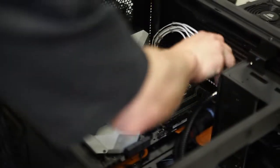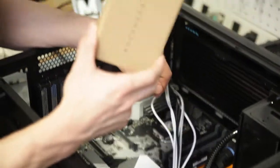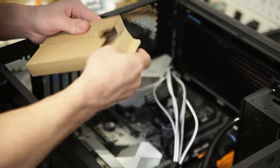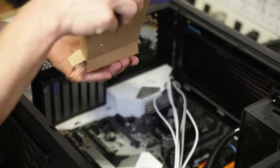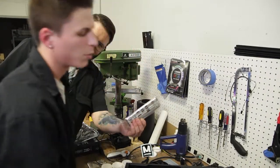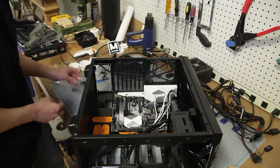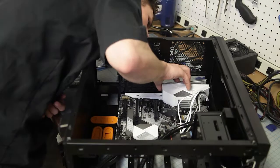To install your motherboard to the case, you're going to need to go into that accessory box, which has all the screws you need to mount the motherboard. If you wanted to add additional hard drives or anything like that, all of the hardware is in there. Make sure you put in your I/O panel — sometimes it does not come pre-installed, so you need to put it on the case before you put the motherboard in.